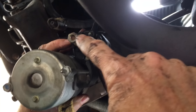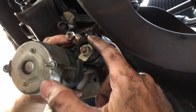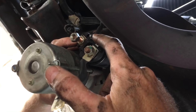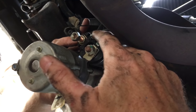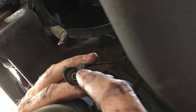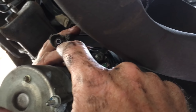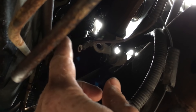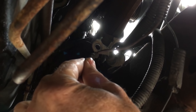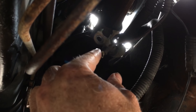Alright, here's what we got: this nut was on the main big battery wire, and then there's another smaller nut right here that you need to undo — you won't get them mixed up. There's also some kind of temperature or oil pressure sensor that I had to unplug to get slack; it plugs into the block. This is a good time to check that the wires aren't loose, and you can sand and clean the connections so you're making good contact.